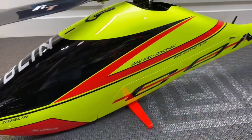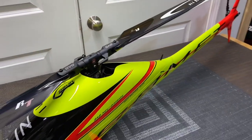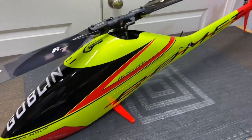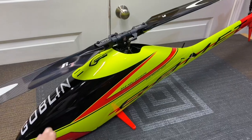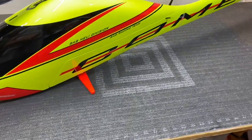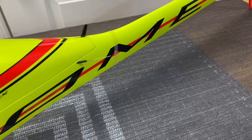One step closer. The Comet is flipped back over sitting on its skids and we just threw on some Rototech 715 Ultimates. Now these blades are only for testing — they are not for official speed runs. We also got the 96 millimeter tail blades, the Ultimates — again, only for testing just to get the helicopter flying and set up. I didn't want to run the 720s. So it is officially done and ready for phase one, which is just the testing stage. We are going to officially go for the world record — that's what we are going to do with this Comet. We have a completely new power system, way more power, and the first maiden flights will be done on 14S and we're going to go up from there. Thank you guys so much for watching — if you haven't already hit that like button, hit that subscribe button, Patreon and PayPal in the description below. Take care and have a great day.